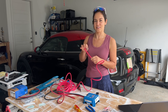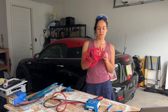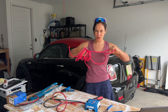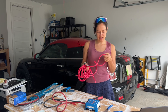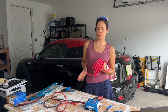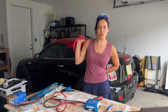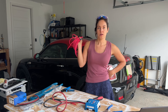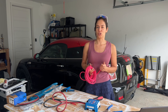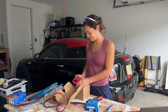I actually don't love it. The insulation is kind of plasticky. I'm actually not going to be using this. I don't like the jacketing — there's no temperature rating printed on the jacket either. It just feels very plasticky and I just have a bad feeling about it. In electrical stuff, if you have a bad feeling, you have to go with your gut. So I'm going to return this to Amazon and go with Windy Nation. It's a little bit more expensive, but Windy Nation is a legit company. Otherwise this project will be tabled for another four days. Bye bye pink wire.